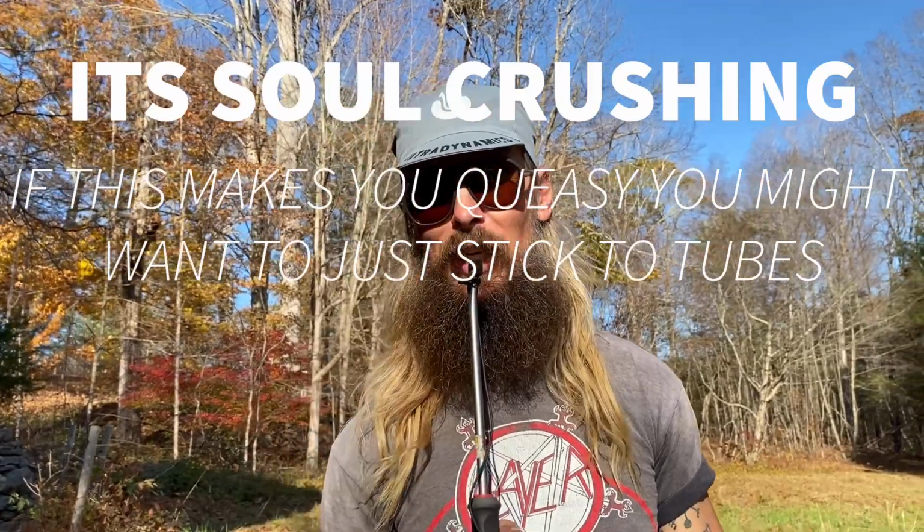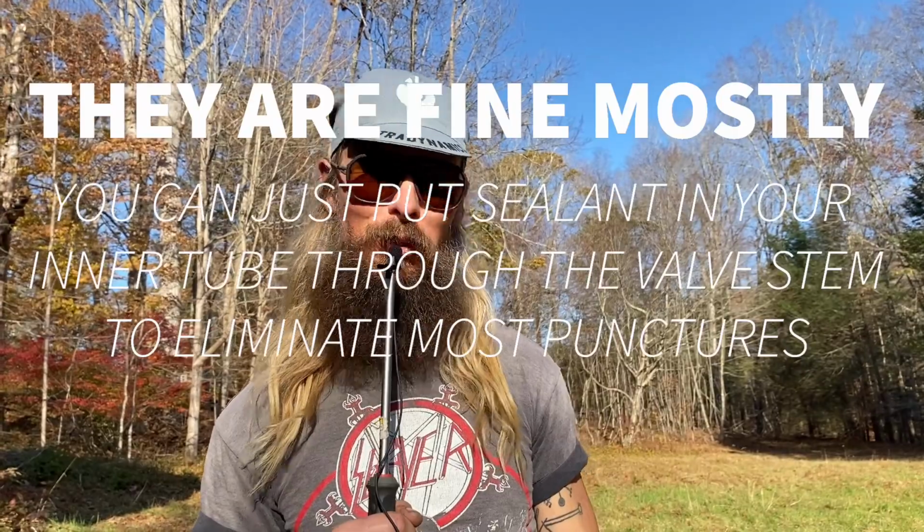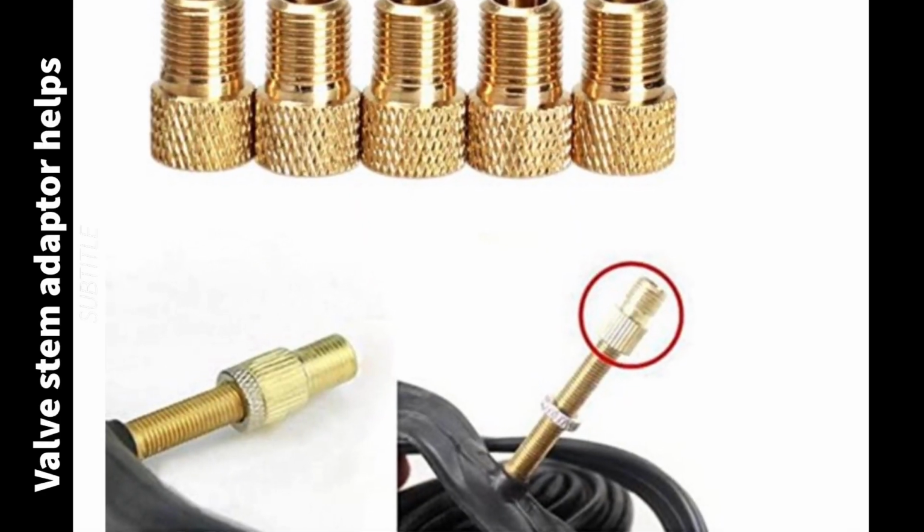One more thing you might have to troubleshoot for is if that air chamber hadn't worked for me, which is probably, maybe one time out of four the case. That you're going to need an air compressor. Not everyone has an air compressor at their home, but that's okay. If you got a gas station nearby, you could just use that. Go to the gas station, use their air compressor. Just be sure you remove that valve core so you're shooting all the air in at once. Snap, snap, crackle, pop. That's what they'll hear at the gas station.